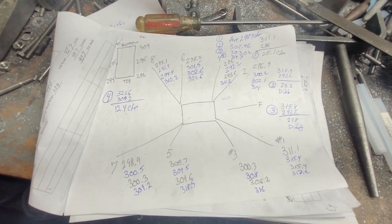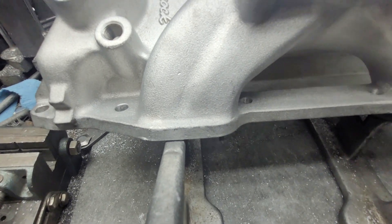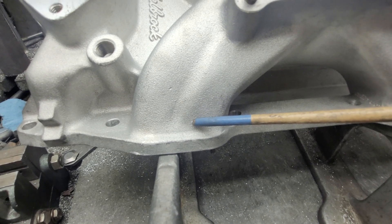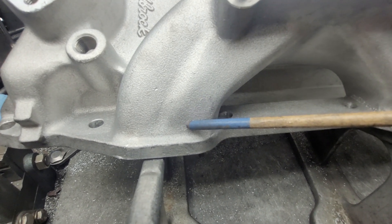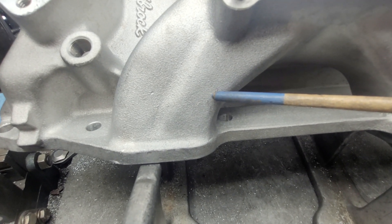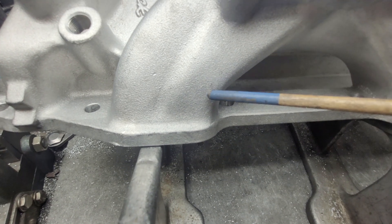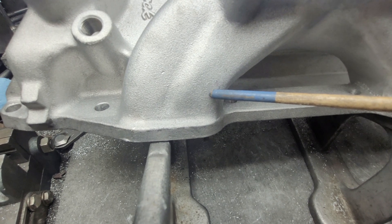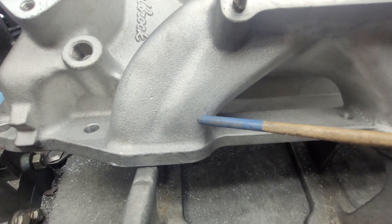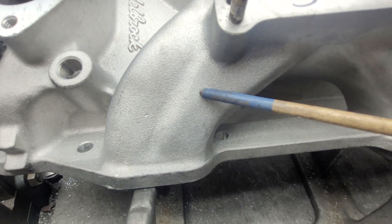When I did it for DV and Terry — let me grab the manifold off the bench and I'll show you. On the Wilson manifold, first of all, it had already been modified for fuel injection, so I had to fix that up. But somebody opened it up at the gasket quite big, and then it necked down at the apex a lot. So it was wide, necked down, and then went into the runner. Having your minimum cross-section at the apex of the turn is not the way to do it — I can say that pretty much 100%. That's not going to be a high-flowing situation. So do I know whether that was done at Wilson or somebody else did it? I have no idea.